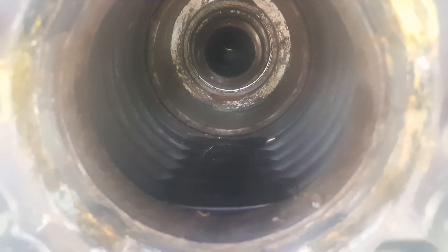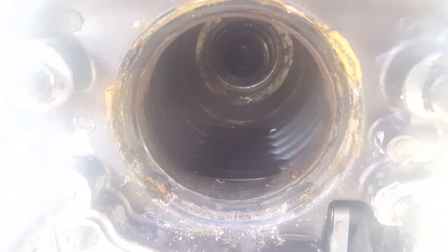I've got water in there now. You can watch it for a little bit and see if it drains out. It's not a perfect test because the bellow will flex — it might not have a hole in one position but then be compressed in the resting position and actually be watertight. Still, this is a really good overview test to see if you have any leaks.